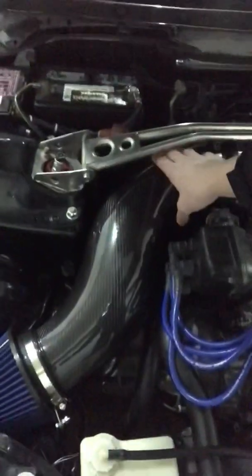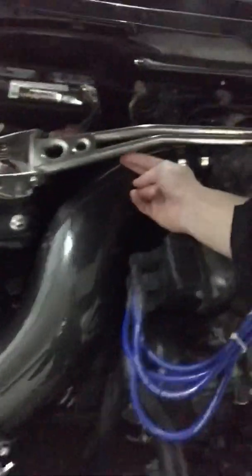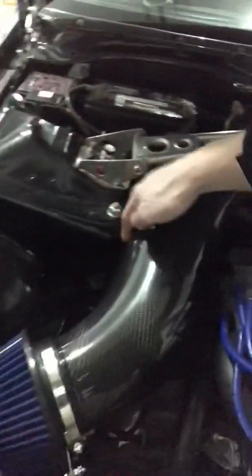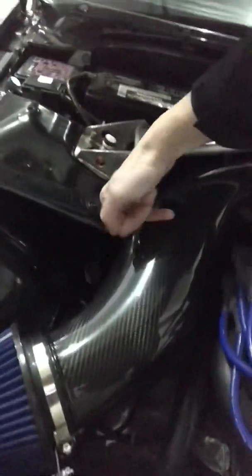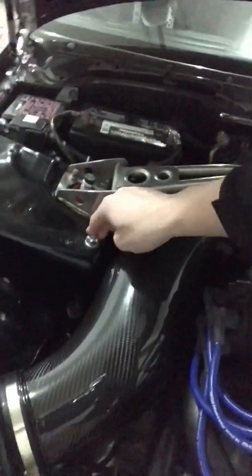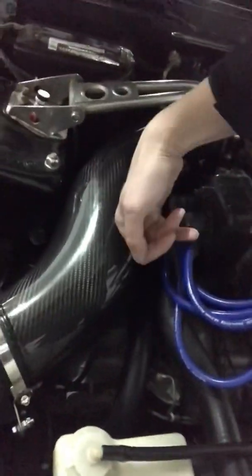It was a little snug to get it in, and I have enough gap here. I got about 2 fingers gap under the main front pillar support bar. I got about a pinky finger right here for gap in between the shock tower / strut tower, and then I have about a pinky or so between the distributor cap top and whatnot.